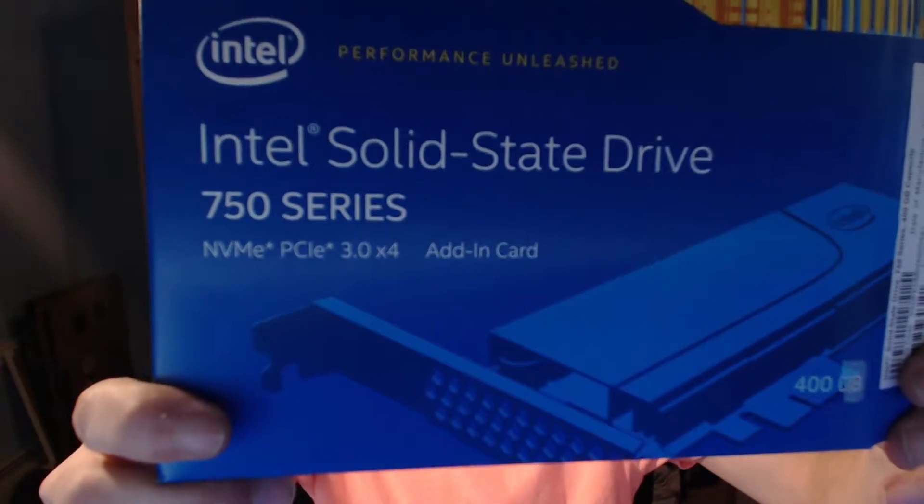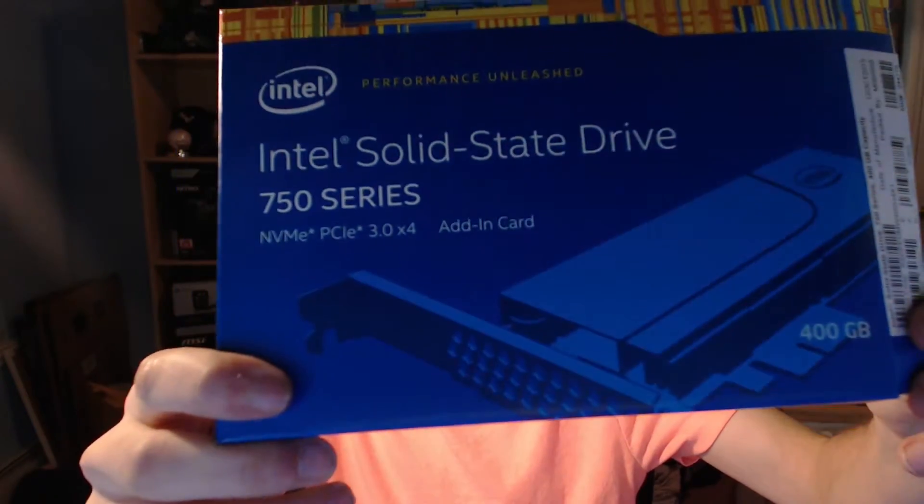Second of all, it's not even supported to boot from for almost any AMD chipset. I've seen some very special cases where it is supported, but only on a certain processor with a certain chipset. Bottom line: AMD, you're pretty much out of luck. I have an AMD and thought you just put the add-in card in, boot it up, install Windows, and you're done — wrong. You need a compatible motherboard. It is so cutting-edge because of the new NVMe controller that you cannot use it on just any old motherboard.